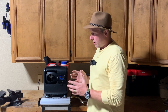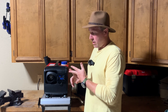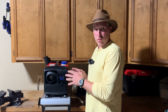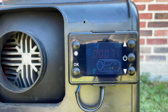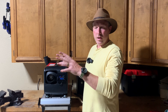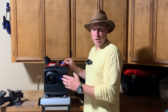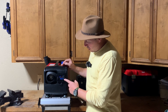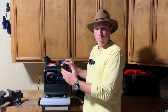Now that you know the general parameters, set your fan speed to 1,500 for the low and 4,300 for the high speed. Then go ahead and turn on the actual heater itself. Let it come up to full operating temperature — you'll see all the bars come across and the fan will start spinning. Once you get to that second red bar, it'll take about another minute or two, and then you'll hear the fan speed come down to whatever your general P setting is. Once it finds optimum temperature, it'll settle out and you won't hear any more fluctuation — that's when you know it's time to start tuning.